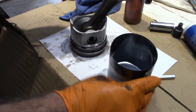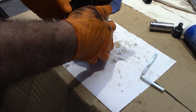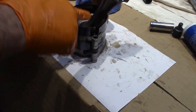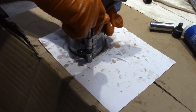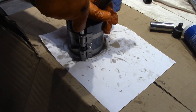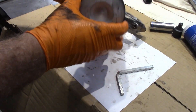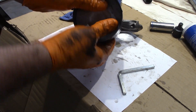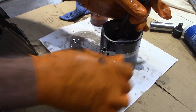Be sure you're well oiled in here. I'll put some more oil on the outside of this piston. If you're using one of these, be sure you've got the coil that's on that band on the outside pushed down nice and flat, and then tighten it up for all you're worth. Now I'm going to push it down to the other end — that's the end it's going to go out. Give it one more squeeze and then we're ready to install it.